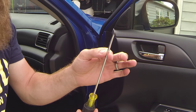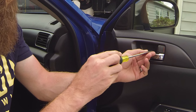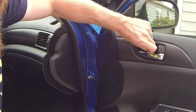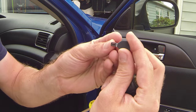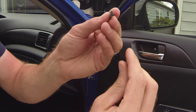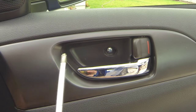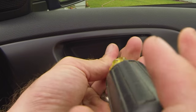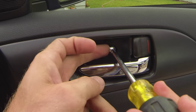First we're gonna start with this little tab right here. Take a flathead screwdriver and insert it to pry very gently — you don't want to break this. It comes out really quick, kind of folds from that end. It's been taken out before so it's got some plastic issues around it, but take that out and set it to the side. After that, take your Phillips screwdriver, insert it into the Phillips screw, back that out counterclockwise, take the screw out and lay it to the side.